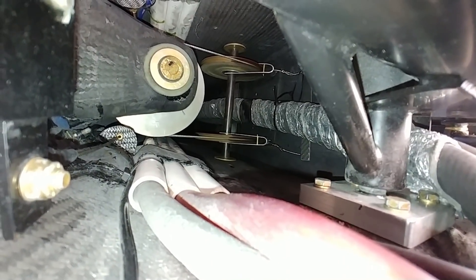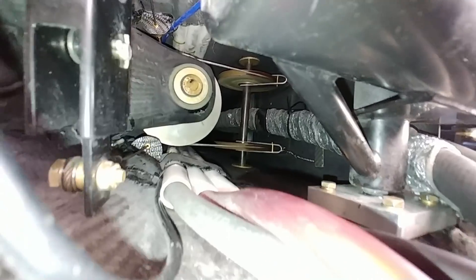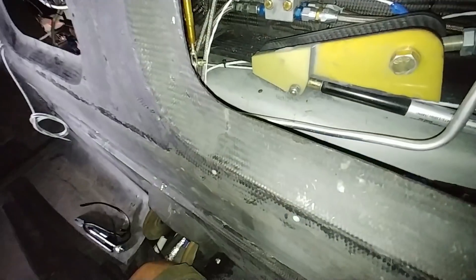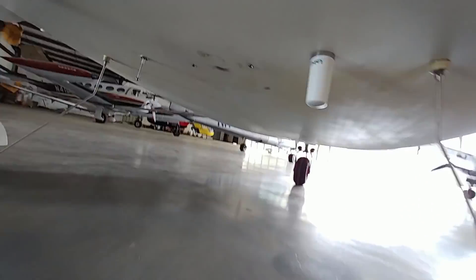The next one to get done was up in the keel here. What I've done is put a piece of carbon fiber there with some holes in it — that's underneath all the hoses running there — and anchored that to the floor, with the safety wires pulling those things back so they can't move. Then likewise down here in the keel, which is a bit more tricky. I reused the holes I had in the keel before from securing those pulleys. I got a bolt there, put a washer on it, got the safety wire under the washer, and the safety wire loops back around the cable guard. The bolt heads are pretty flush — just rounded off heads — so that has anchored those ones.